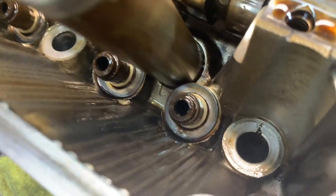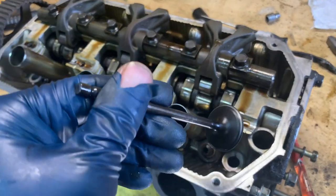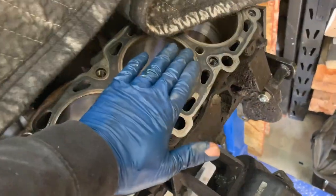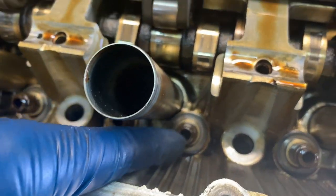This is an old one. They get really hard and brittle and they no longer are supple and they no longer have that kind of retention. This is flying around in your motor at several thousand RPM, going up and down multiple times a second. Oil gets past this really crusty seal and it comes down from the head into the combustion chamber and burns right here in your cylinder. The head goes right on top, it burns in the cylinder, goes out the exhaust. That's why you see blue smoke coming out of your tailpipe. That's why it smells bad.